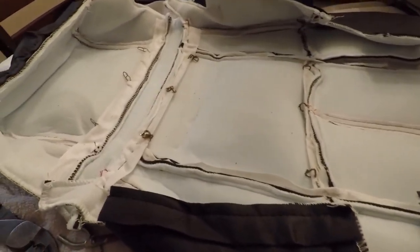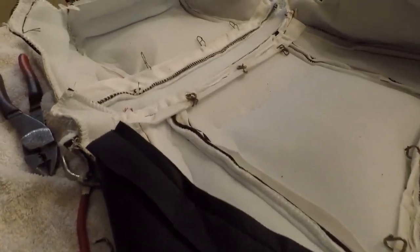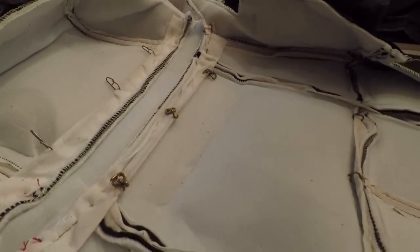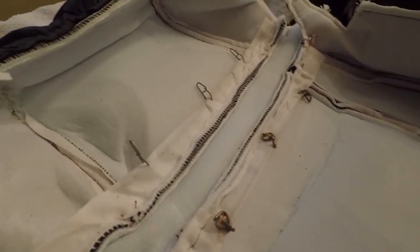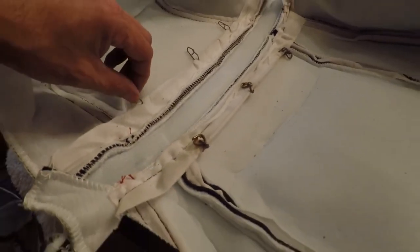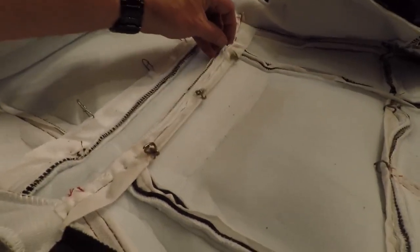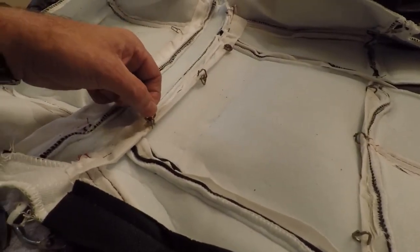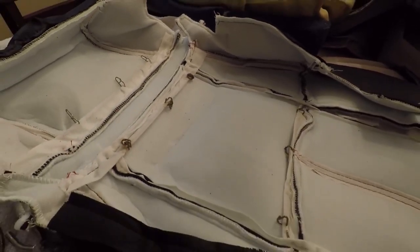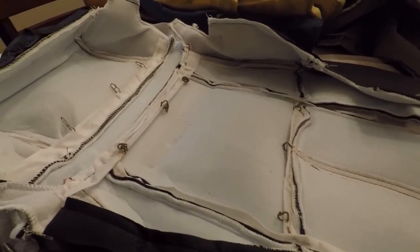Before I put the cover back on, I just wanted to show you what I did. I transferred those little wires into the new cover — into here, here, and here. I know I said I was going to use wire ties to put this all together, and I do plan on doing that all the way around the edges. But for these inner hooks, I wanted to make sure this was not going to come loose, so I went ahead and re-straightened all the hog rings that lock those little guys into place, so I can push them through the foam. Then I can run those wires back through and that'll lock it into the foam. Once that's done, it's just a matter of going through all around the edges and tying them onto the frame. We'll come back once I've got the cover on and show you the end result.